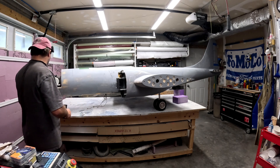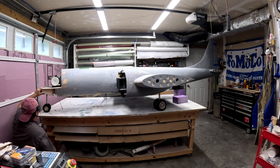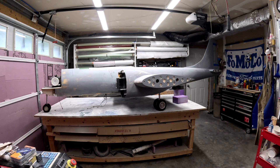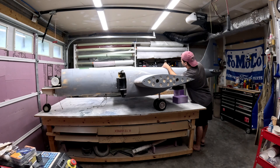The whole thing sits at zero-zero right now - that's a good start. That's with no weight on it; there's no compression on the nose gear. Once we put some weight on with the wings, tail, engines, and all that stuff, back here it's still showing pretty much zero degrees. Put some weight on it and we get about a degree out of it.